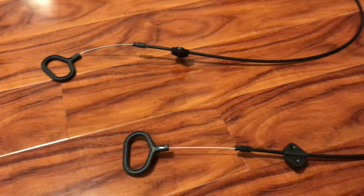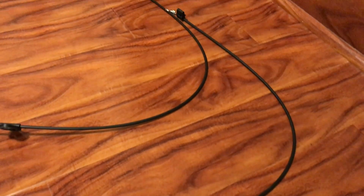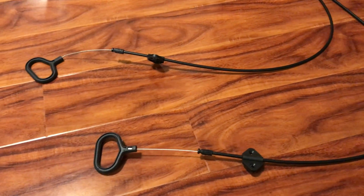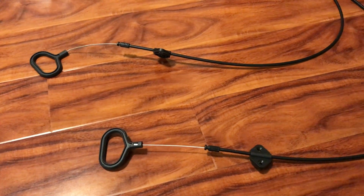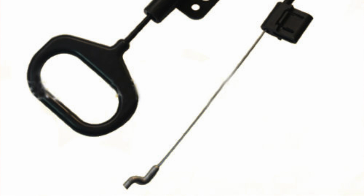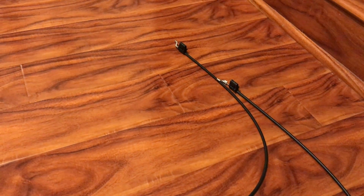There's two basic systems for how these recliners work. There's the pull handle, which are the big levers on the side, and then this type. These have a cable release. There's 2 or 3 different kinds of cable releases, so before you order your parts, make sure you figure out which ones you need. There's these type with the pull handle. There's also one with a little pull lever, and then some have a return spring at one end, and some do not. And we'll have all the different types linked in the description below, so you can hop online and check out which one you have before you go and order parts.